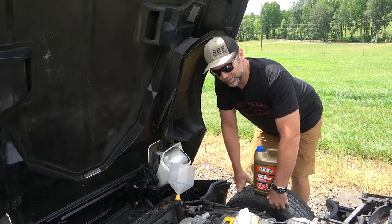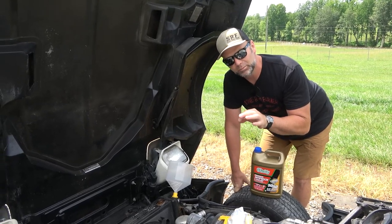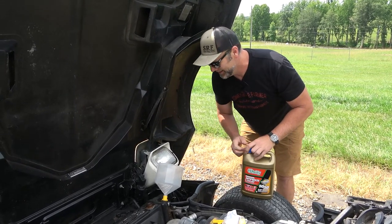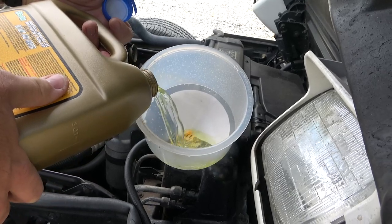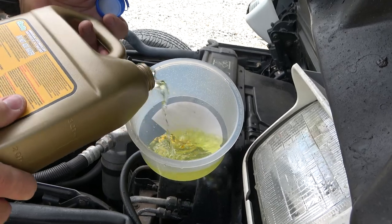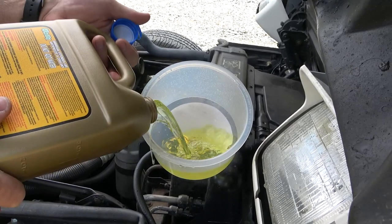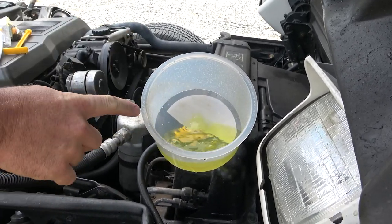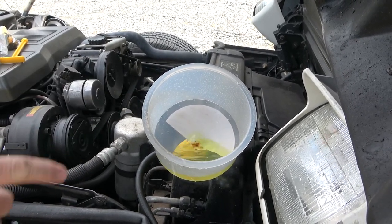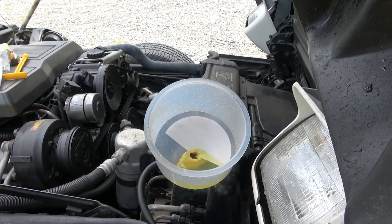What inevitably happened here is that this fella drained all the coolant and did not get it all back in place. He had to replace a freeze plug in the side of this engine, and that's why it broke down. You can see the air bubbles coming out right here. What we're doing is using gravity — gravity is letting the air come out. This actually works better if the front of the car is pointed up the hill. We might just pull up to the top of the hill and angle the car. We're going to start the car, let it run for a bit, and let it kick all the air out.